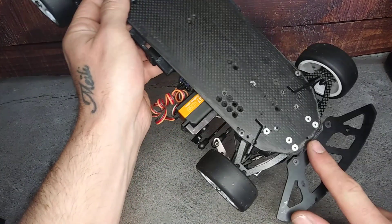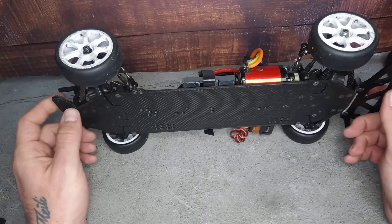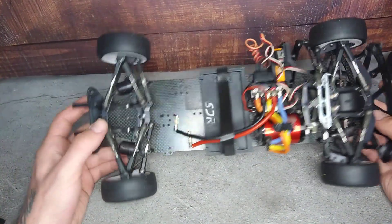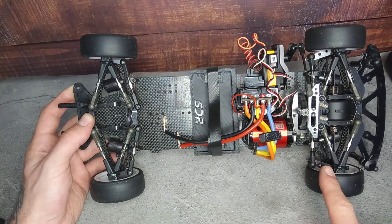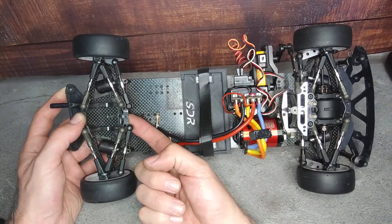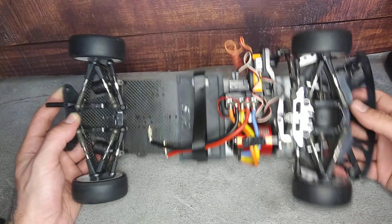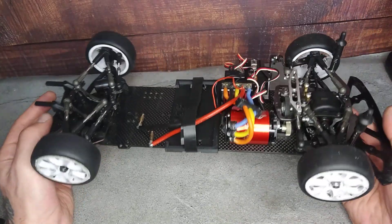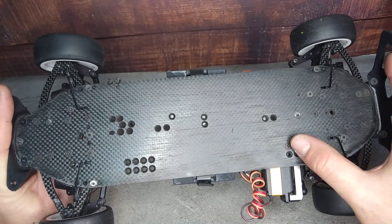Originally this is the front of the chassis and this is the rear. I didn't want to fiddle with it too much or do a lot of construction — I wanted to convert it using as much of the original parts as possible. So I switched sides. The only thing I moved was the steering. The steering rack used to be attached at the bottom, and I found the mounting holes are pretty much the same as the holes up top, so I remounted the steering rack with some little brass spacers.